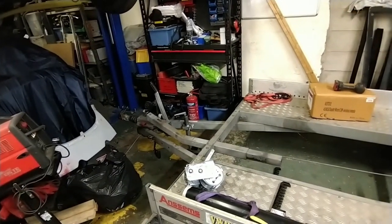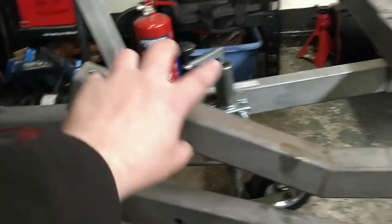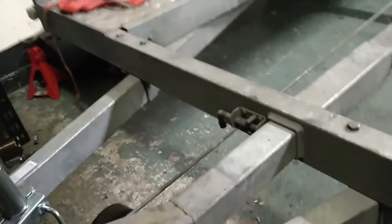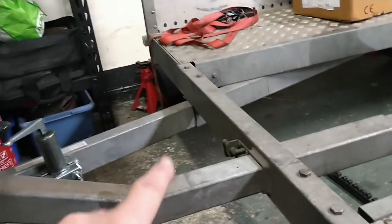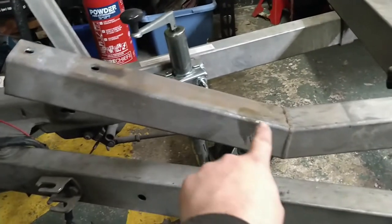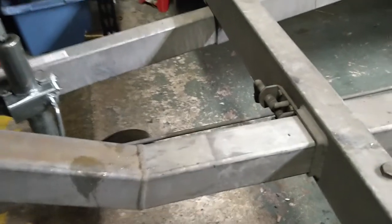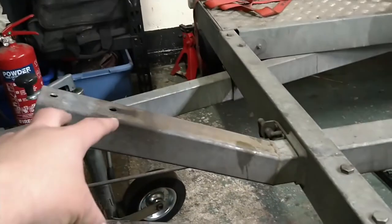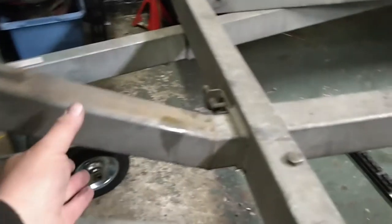Using the hand winch is a pain, so today's job is to put that electric winch on. It's not as straightforward as it first appears because there isn't really a place to mount the winch on the trailer. From the factory, the trailer comes with this arm and the winch mounts on top. The arm is not central to the trailer, which means the winch is always off to one side. My plan is to pull it out — it's adjustable — and flip it 90 degrees so it's lying flat, then mount the winch to that face so it's in the middle.